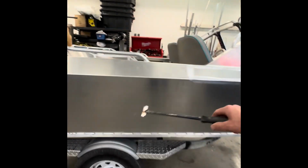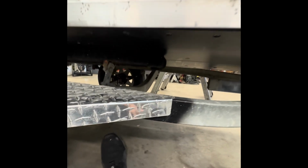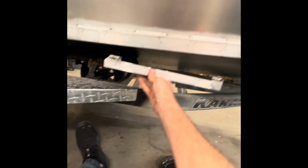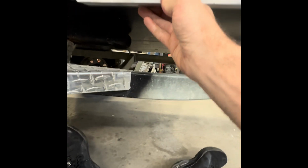Putting the sides on, like this panel, fitting it up past the flat section. Once it starts to curve up, I'll show you my trick. If I can find my one piece of aluminum angle that I used. There we go. Okay. So, I notched this piece of aluminum out. Forget about this chine guard being there. This is first stage of assembly. I would weld this piece on about an inch back, right? Just an inch long stitch. That's about it. Right there like that.